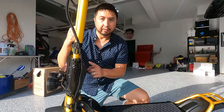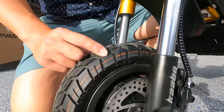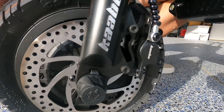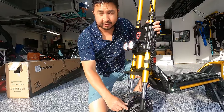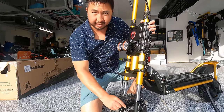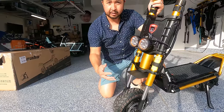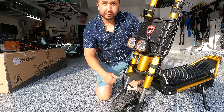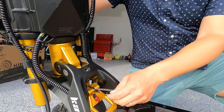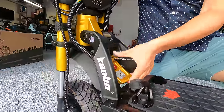That's where the 100 amp controller is located. You have the 12 inch by 4 inch hybrid off-road tires — a sweet addition. Zoom hydraulic brake calipers with 160 millimeter brake discs that are nice and thick, introduced on the previous version for better stopping power. One other thing about the tires: there's a tire sealant gel that lines the tire, so if you get a nail or a goathead in there it should self-seal. The folding mechanism is similar to all the Wolf series but seems a little more rigid. I do wish they fixed the folding chain though — it's pretty garbage and they'll break within a few weeks.